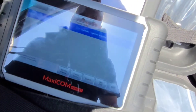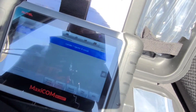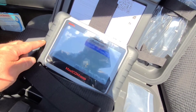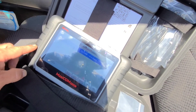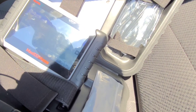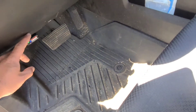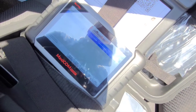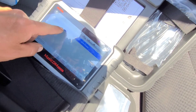P207 — that's a cylinder 7 injector circuit. This right here is another cool tool I wound up with; it's borrowed but I'm going to be buying one eventually. It's Bluetooth, plugs in right here, and so far it's pretty great. It does let you do the manual forced regen and all that stuff, but it also reads the code and it says permanent.